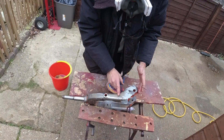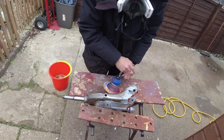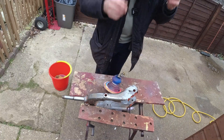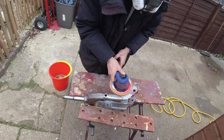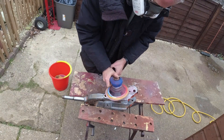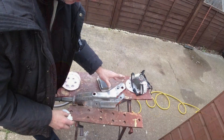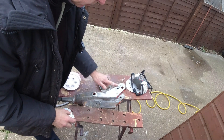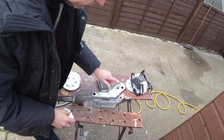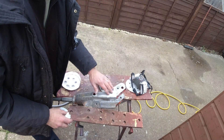Finally back now — the fiberglass has dried and I've put a coat of filler on, so I'm just going to go over with the DA now. If there are any more little holes afterwards I'll go back over with them. So let's just quickly start off doing this — I'll just show you the first bit. That's all been sanded down now and it's all quite smooth. Just a few little holes where it's sunk in, but just a slight smear of filler in there and that should be smooth. Hopefully we'll be ready for paint after this one.